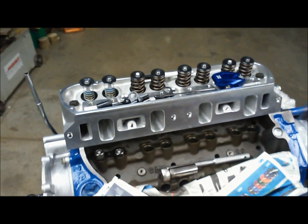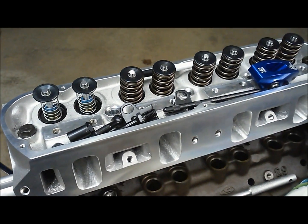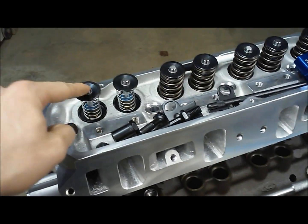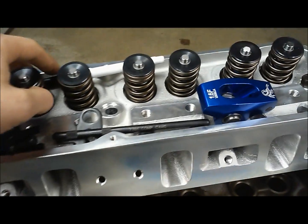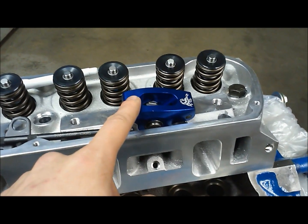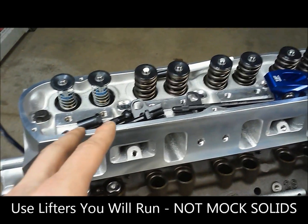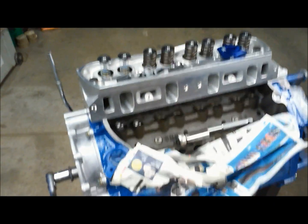Some of the essential parts and pieces you need: first, lightened valve springs — I've already switched out the supplied valve springs for these, picked up at my local hardware store for a couple of bucks. You also want a whiteboard marker, an adjustable pushrod length checker, the actual rocker arm you'll use when the engine is completed, a couple of lifters, your rocker stud assemblies, and a head gasket.